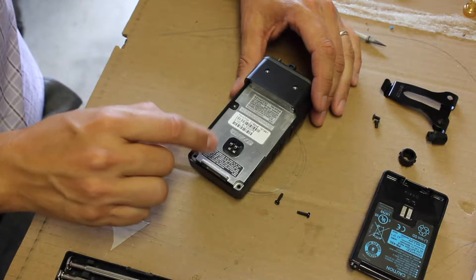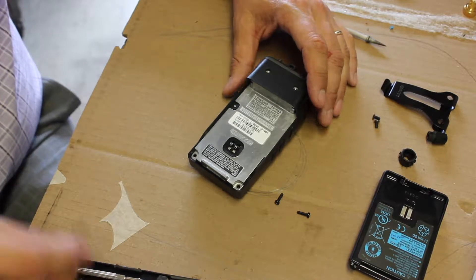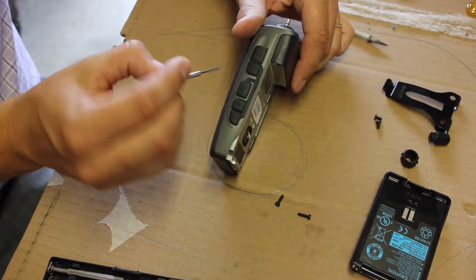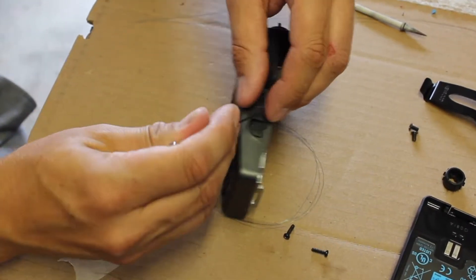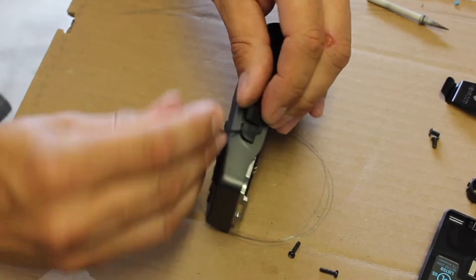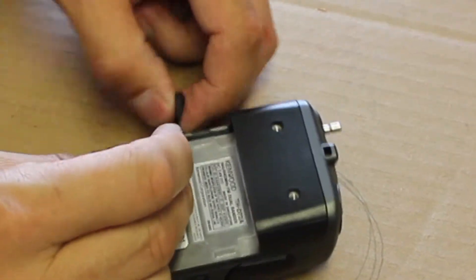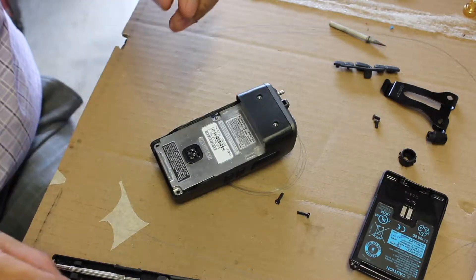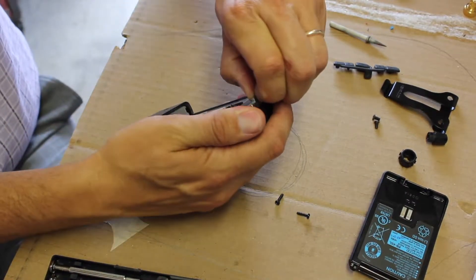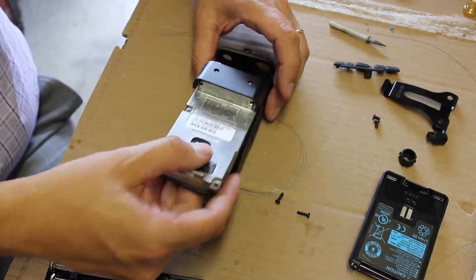Those two screws come out — that's really pretty much all there is for the whole thing. What's going to happen now is this whole inside shifts down. But before that, there's one other thing to take care of: this little weatherproofing for all these little gadgets, which is nice to know how it gets replaced. Go ahead and take this out, lift this tab up and over, then gently pull it out and set it to the side. Now gently pull the whole assembly up and out, and it comes out.